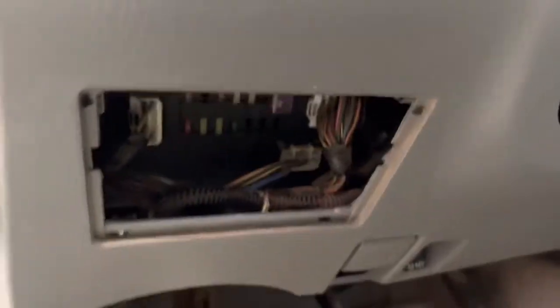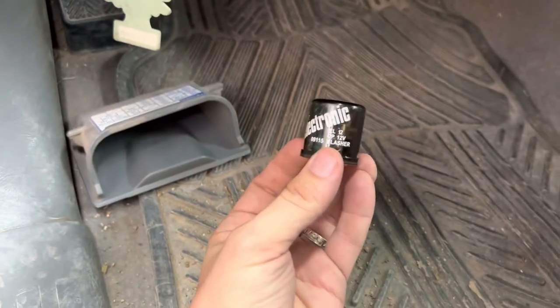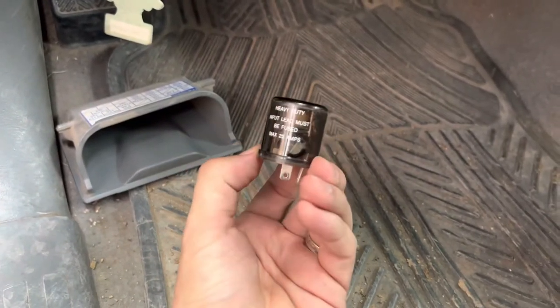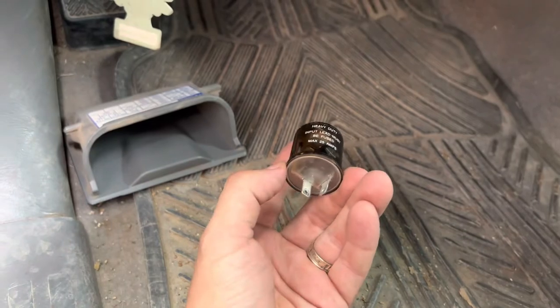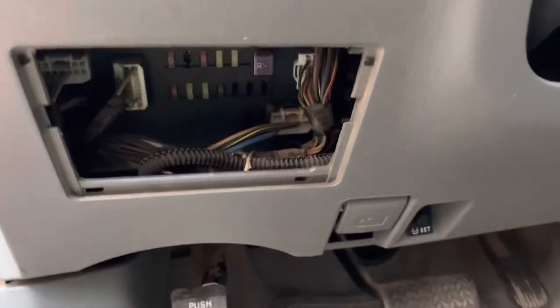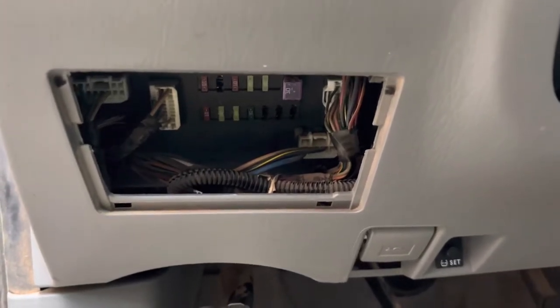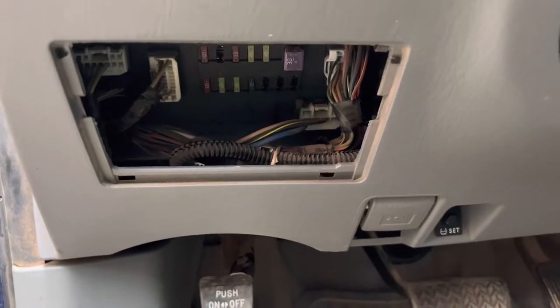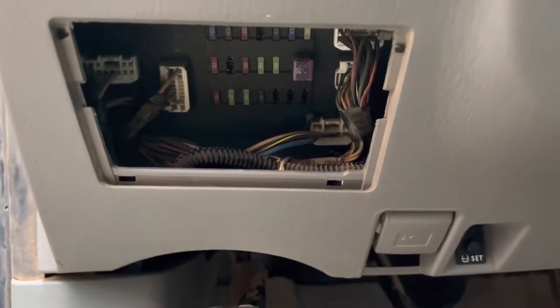Pull off this lower dash — it's not that big of a deal — and then swap in an electronic flasher. This will allow LEDs to blink at the correct rate. I have this from a motorcycle project. There's another version where you just drill out the solder that controls the blink rate. For all I know it might just be doing it because the rear is not plugged in, so I'll test that as well.